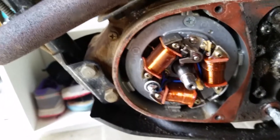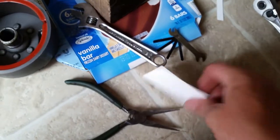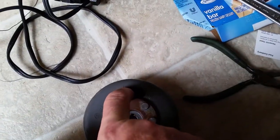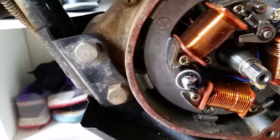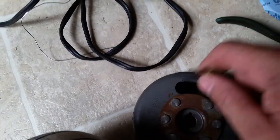You don't need to over-tighten these screws — just wind them in and snug them. Check your gap using a business card you can cut up. Make sure you use a caliper to measure one out. It's a lot easier than dealing with a feeler gauge in there because it's too tight, and if you've got big fingers like me it makes it complicated. A little square right in there will do the trick just fine.